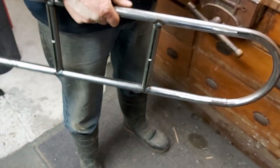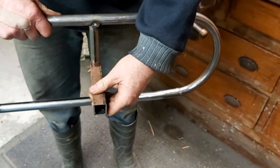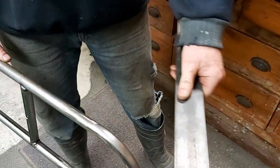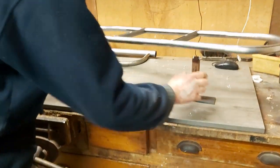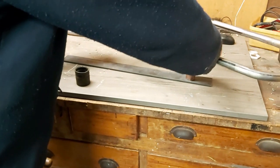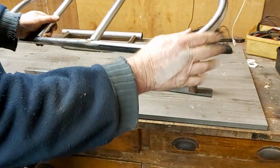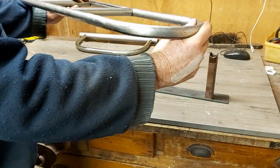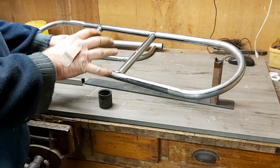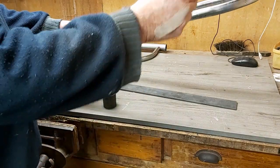The idea is we'll grab a couple of these pieces here we've just cut out, put that on there, and then we've got some steel plate here which we're going to cut and join onto there. This will bolt to the back of the chassis. The bumper is really only there to stop people from rolling up over the back of your wheels — we've seen that happen a few times. It doesn't have to be built out of railway sleepers; the idea is to make it light. If somebody does hit us, we can take it off and repair it fairly easily.